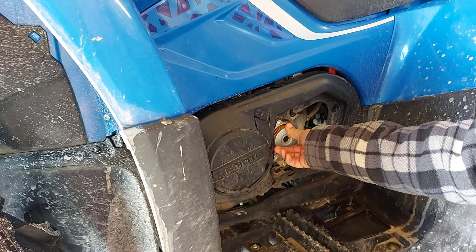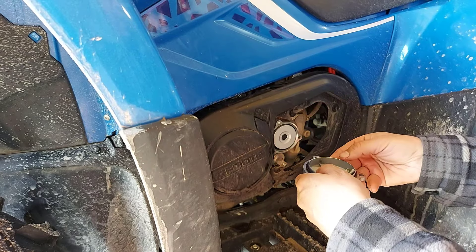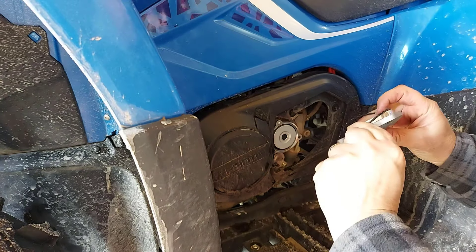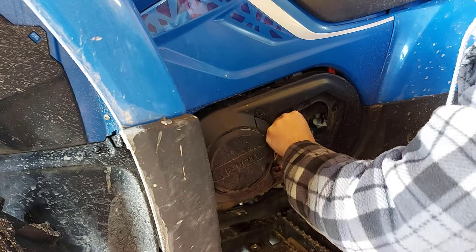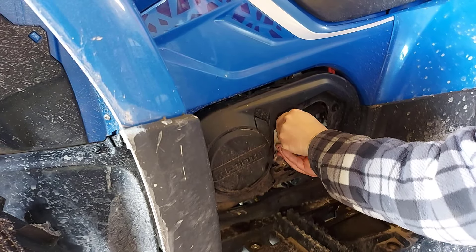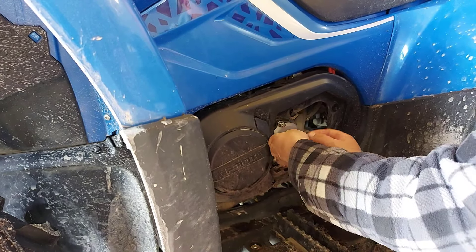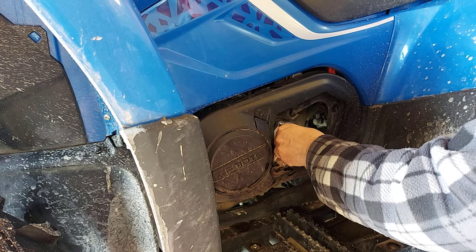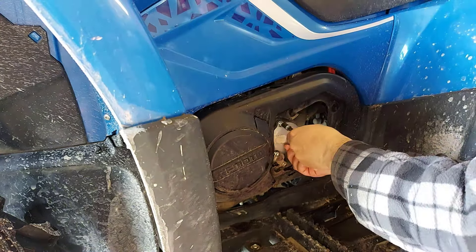Take it and put it in place — it pushes and squeezes up on a nub in there. I cleaned my O-ring and put it on top of the cap here. Get the bolts out and then put this into place. Make sure your O-ring doesn't slip on you like this one just did because I wasn't really paying attention. There you go, got that in place, then put your bolts in — three of them. Hold on to your cap because it'll let go and your O-ring will slip. Then just tighten them up. Just snug them up; it's not like they're going to back out.